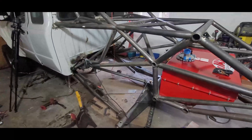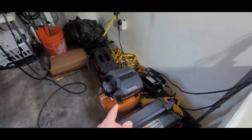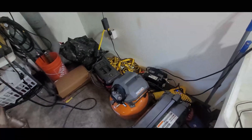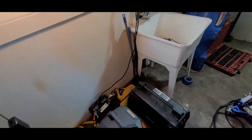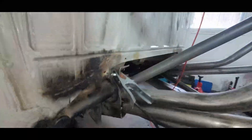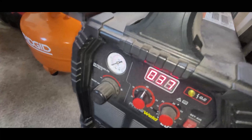It's the next day. I just went to Home Depot and picked up a mini air compressor for a hundred bucks — it flows around 3 CFM. You're supposed to have six for the plasma cutter, so I'm gonna have to wait for it to recharge. I just have to cut this body mount off on each side. Set the post flow to about 10 seconds, probably turn that down a little bit — try it at 40.